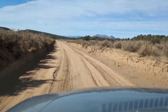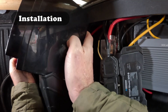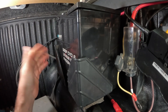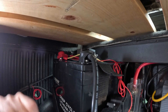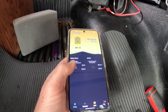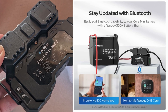We also wanted to test the battery's BMS stability, so we've been deliberately driving through back roads through Oregon, Idaho, Nevada, and Utah — some of those roads have been pretty rough. It hasn't missed a beat with keeping our fridge running. The installation of this battery was pretty simple. We needed to alter the battery box we built for the 50-amp version just a little bit to fit the new dimensions, but other than that it was simply connecting the positive and negative cables. Since this battery does not come with built-in Bluetooth, we installed Renogy's Battery Shunt 300 to communicate between the battery and the Renogy One Core Monitor. You can also use this with the DC Home app, and this shunt can be used with any type of deep-cycle battery from any manufacturer that doesn't have Bluetooth.